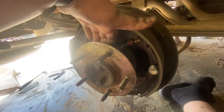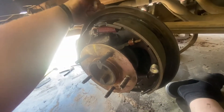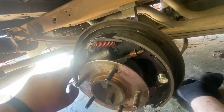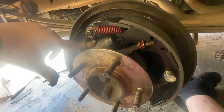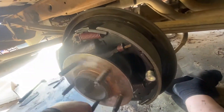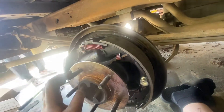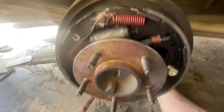Hopefully my hardware comes in for the other side because I need the new hardware for the e-brake cable adjuster. People let these drum brakes intimidate them — they're not that bad. I still prefer disc over drum. This is my first time attempting drum brakes so I had to have a little help; some of these springs were harder for me to get on so I had to get big muscle man over there to do it. Other than that it was relatively easy. We're going to put our drum on, adjust it, do the other side, then bleed the brakes, and hopefully he'll have a nice firm pedal.